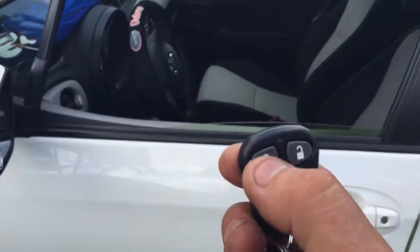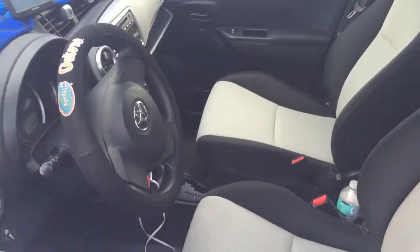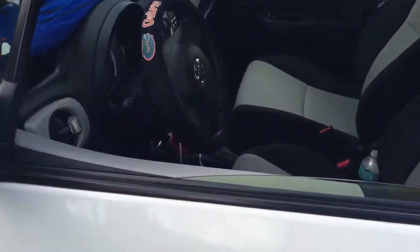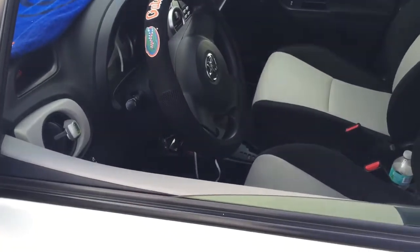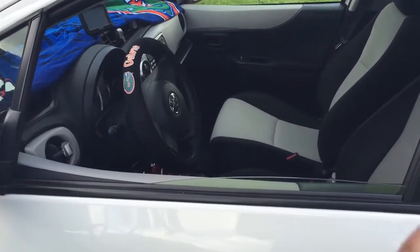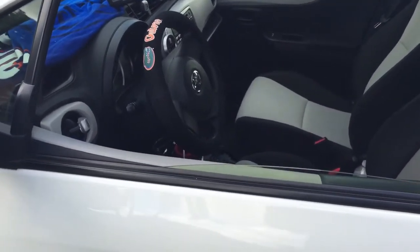I'm going to go ahead and show you guys that on the alarm. That locks the doors and turns on the system. To disarm, you hit unlock — that will unlock the doors and turn off the alarm. The reason why you heard four chirps is because we fired off the alarm. Normally you should get two. Two means everything was fine. When you get four, that means the alarm went off while you were away. One will always mean armed.